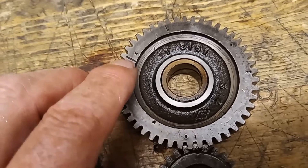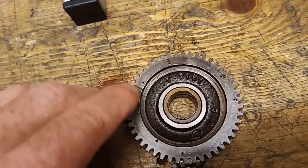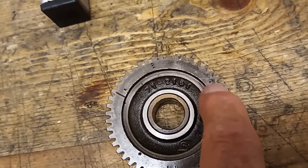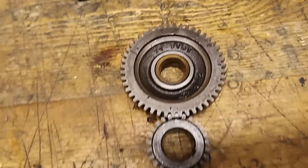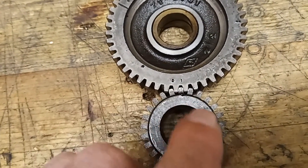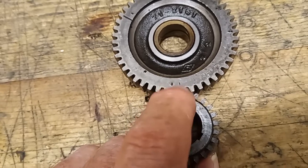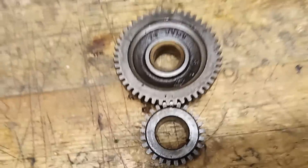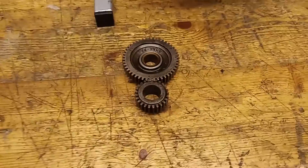There's a dash and a dot - that's the inlet marking and that's the exhaust marking for the originals. All those other marks who knows. I'm confused as to why those two dashes aren't over the center of the gap, but I assume they're there and we'll check it all when it's on.